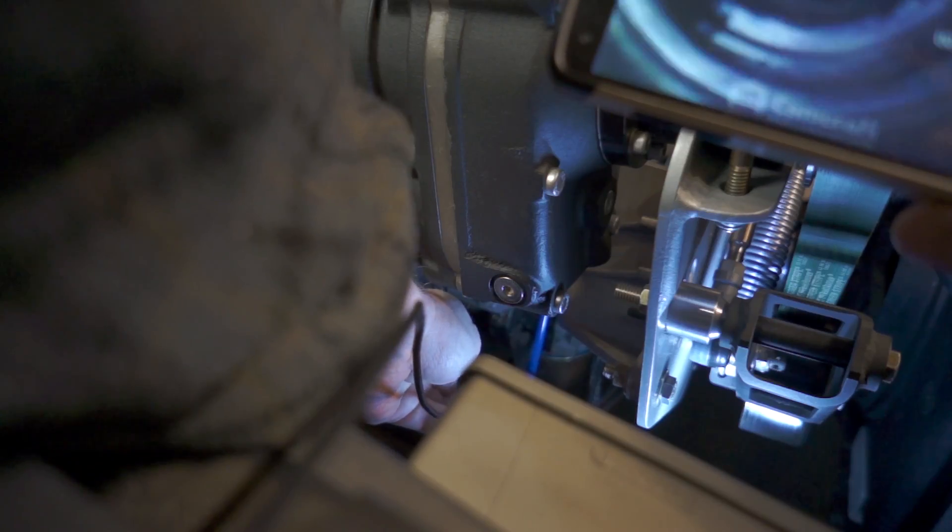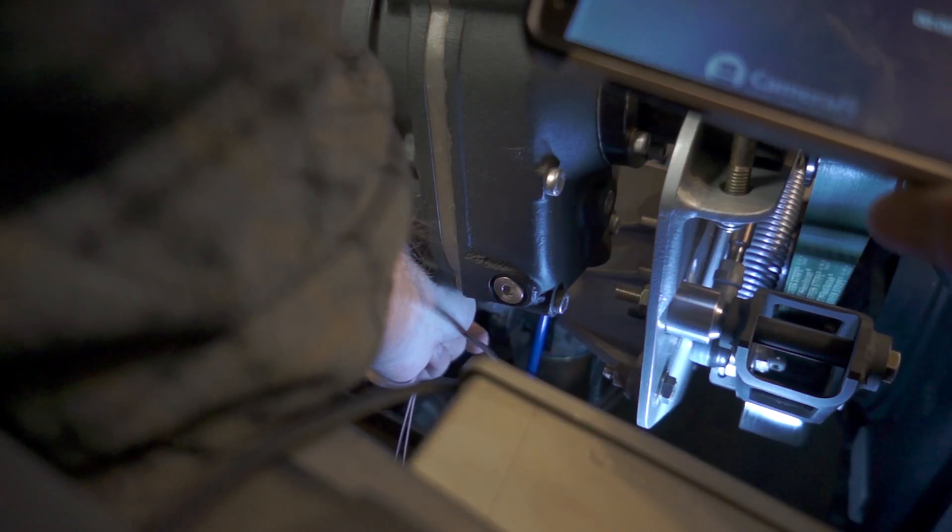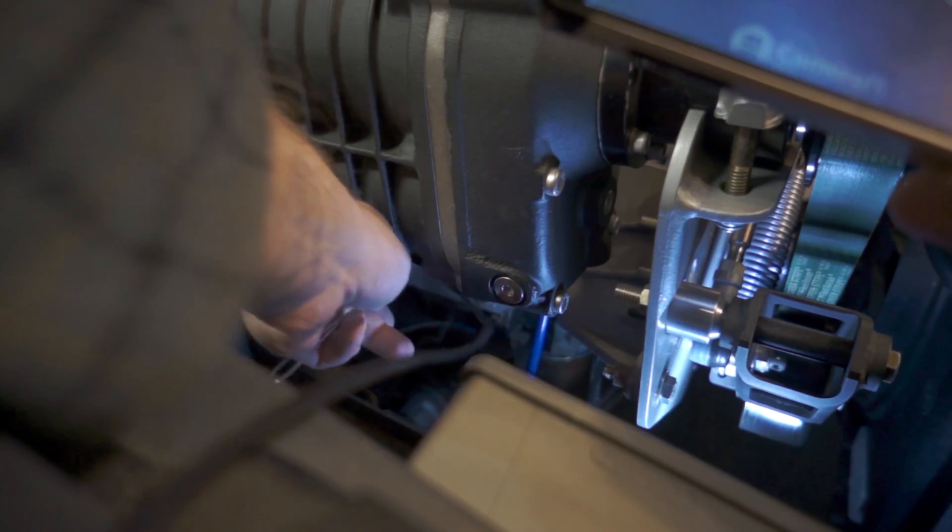We are in the cylinder. This looks like a cross between a deep-sea dive and a sonogram of some sort. This is roughly the 7 o'clock position on the piston. You can see that it's been cleaned by some sort of action — I'm going to guess fuel sitting or condensation, since the car's been sitting for a while. Let's go look at the top right-hand corner where they always fail. Everything looks pretty good up there.